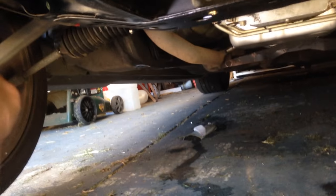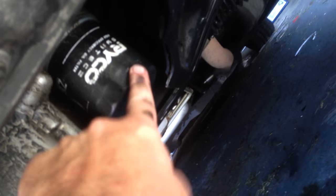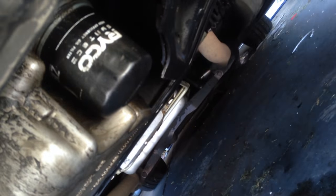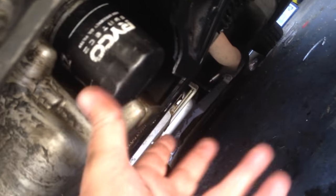Remove your oil filter just with the standard oil filter wrench — spin that off. When you put the new one on, put a film of clean oil just around the top of it to seal it. Then you can pretty much just wind it on by hand really tight, or you can nip it up slightly with a wrench, which is probably advisable.